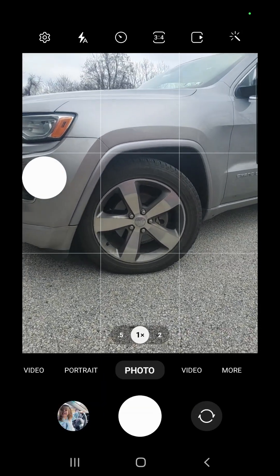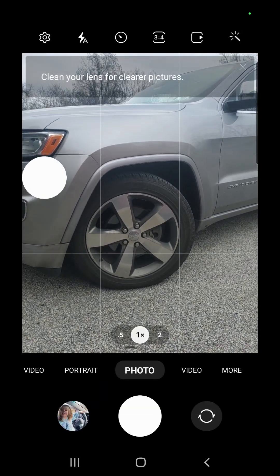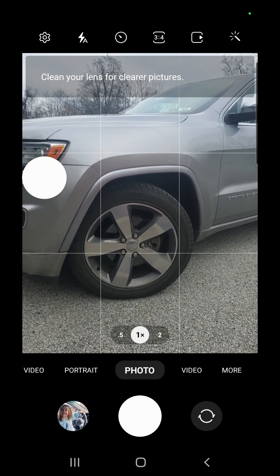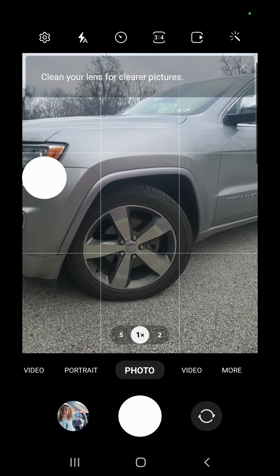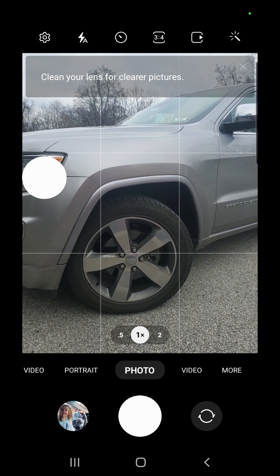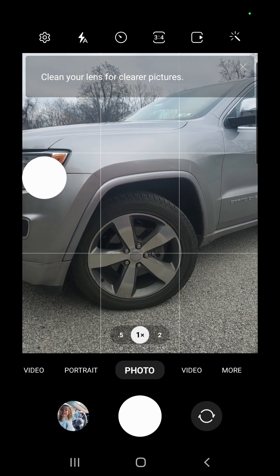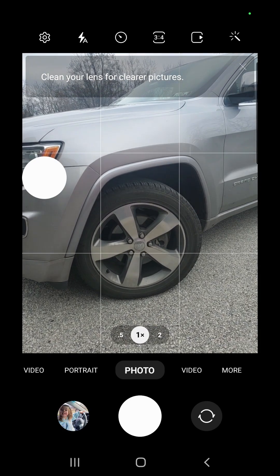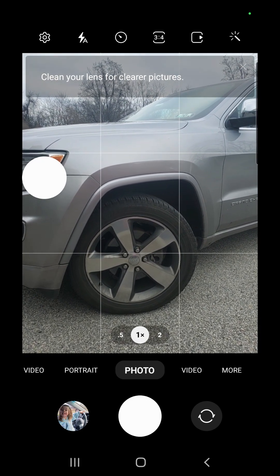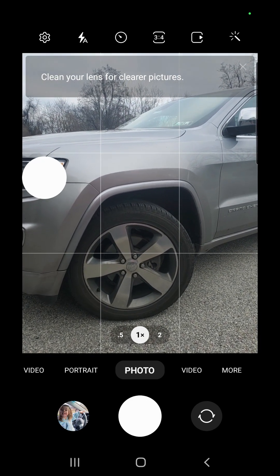I have a sneaking suspicion that the air suspension on this 2014 WK2 Grand Jeep Cherokee has a leak in it. I'm going to confirm whether it's actually in the strut or whether it might be the valve block. You can hear it going up now — it looks to me as though it does have a leak. If it's not the bags, then it might be the actual valve block, but it looks like it's about the bag because the car is actually adjusting itself right now.